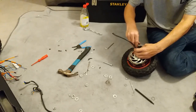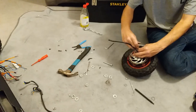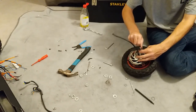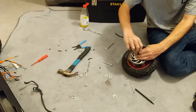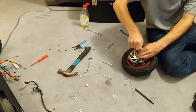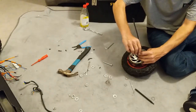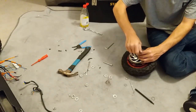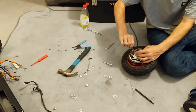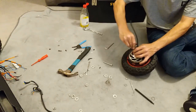I'm going to see if I can get some more heat shrink over this wire because I think it needs more protection than it currently has. The plan is to move the main motor connector block toward the rear indicator, which is much easier to take off. That way I can remove the motor without going through the front and dealing with all those wires — that's why I didn't mind cutting it clean off.